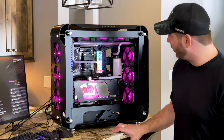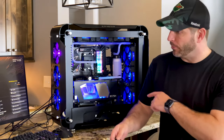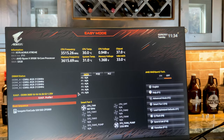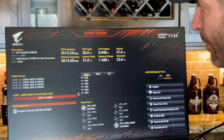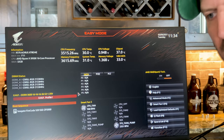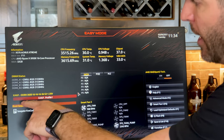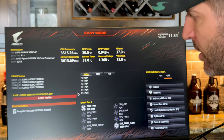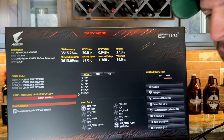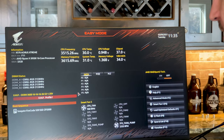Overall I'm very pleased with how everything looks. Now let's look at the BIOS. First off, it recognizes that I've got 32 gigs of RAM installed. I did switch the kit from the 64 gig kit — I'm going to put that back into Genesis. For Vortex, I'm using a 32 gig kit running at 3600 speed, CL16. It is recognized and I do have the XMP profile set, so that is awesome.